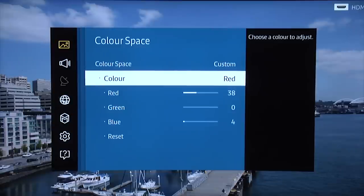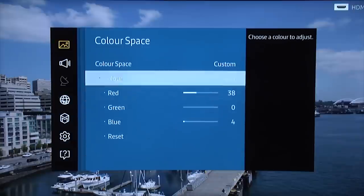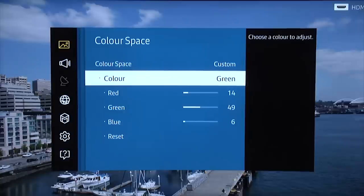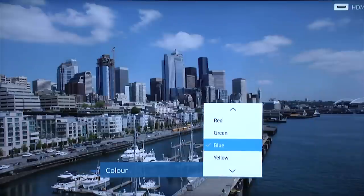But if you want to try it out on your TV, and we can't guarantee this will make any difference, it may make things worse and not improve them, but if you want to try it, you can set the red for red 38, green 0, blue 4, and for green, red 14, green 49, blue 6, and for blue, red 2, green 6, blue 44,